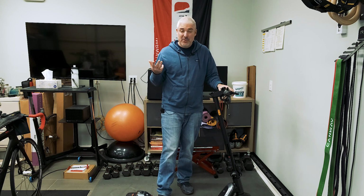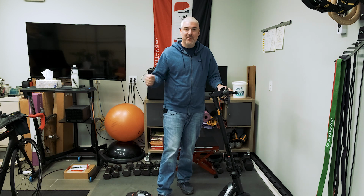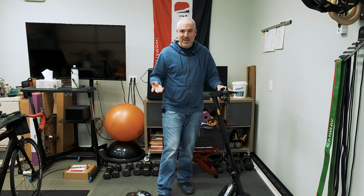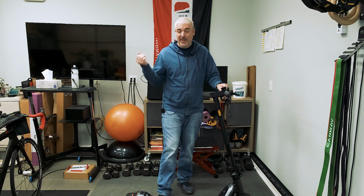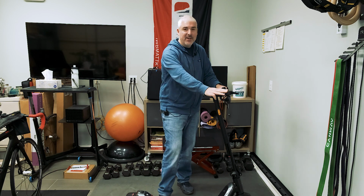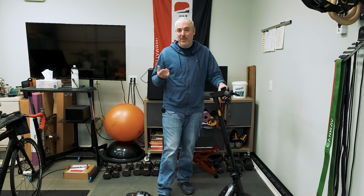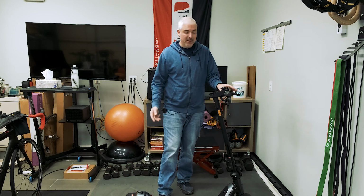It's similar to what you might have experienced with a Tesla or engine braking in a gas-powered car, where if you leave the car in gear and take your foot off the gas, the engine will kind of slow you down. I find that to be nice, particularly there's some hills here and going down some of the bigger hills, I could lay off the throttle a little bit and that regenerative braking would keep my speed in check versus, I assume if you turn that off, you just sort of freewheel and could end up moving pretty good